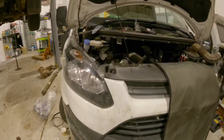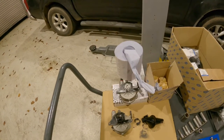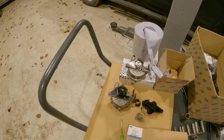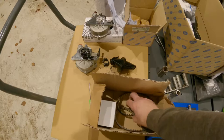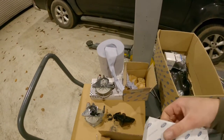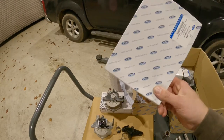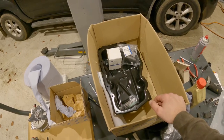To get the job done, we've got our new brake vacuum pump which runs off the back of the camshaft. We've got a new timing belt — that comes as a kit from Ford — so there's a new tensioner and the new belt. I've also ordered the timing belt that runs the oil pump, as that's a rubber belt running in the same oil. And we've got a new oil filter; obviously we'll change the oil and filter.